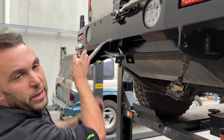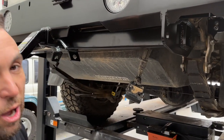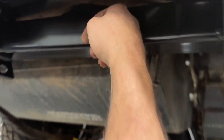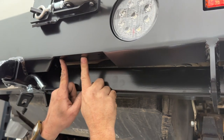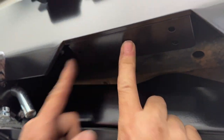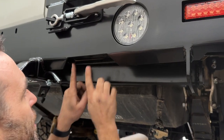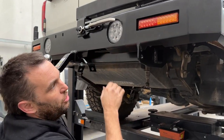While we're here, fit the tow hitch and pin supplied and rattle the bolt up. One thing I forgot to mention when fitting the bar — run the wiring over the top. There are pre-drilled holes here for a seven-pin plug and for an Anderson connector. Run the wire over the top so you can't squash it, then a couple of pop rivets or screws in there. Everything is notched and ready, and you've got your recovery point.